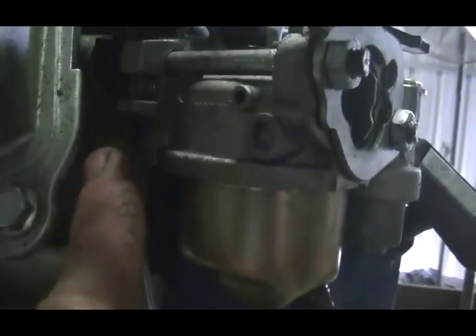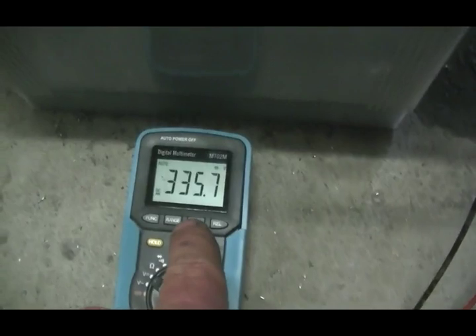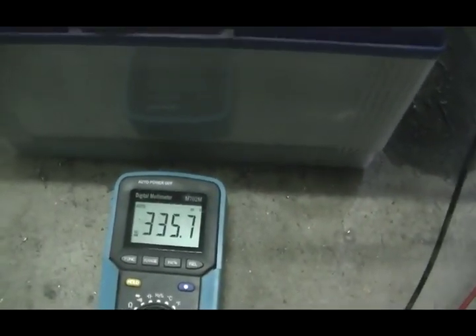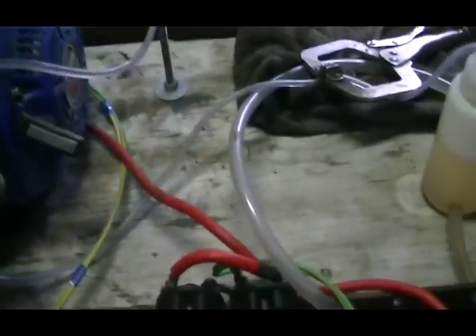I have the bubbler here and the tube — it's just going up into this manifold I made before the carby. At the moment it is capped off, so we can suck in half air into the system. Down here we have a meter that is measuring the voltage across our cell — 335 millivolts at the moment. You will see during the first test that that will not move.